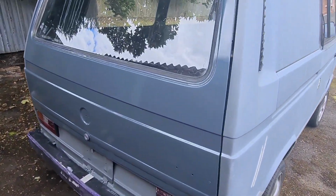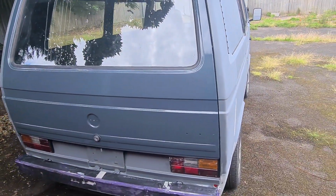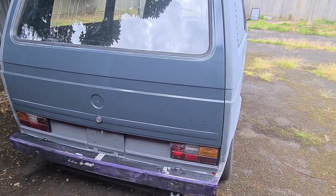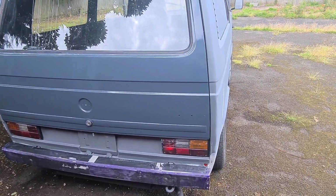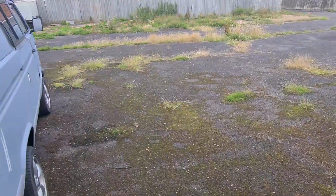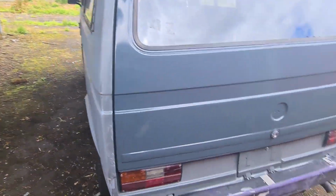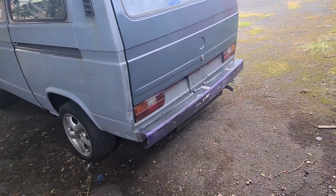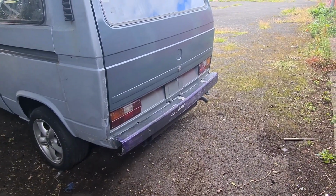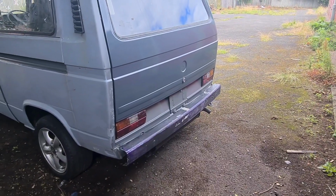This top one now, I know that needs polishing, but that's cellulose, and literally that was drying in 5 or 10 minutes last weekend. Yet this combi colour stuff takes hours and hours and hours to dry. And obviously being around the garage, or even the slightest bit of wind, it was just impossible to keep the panels clean. This colour might work for people that have got units to put them in, but for me outside it just wasn't working.